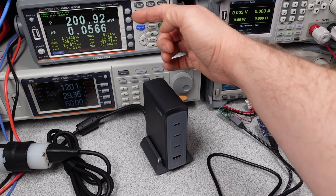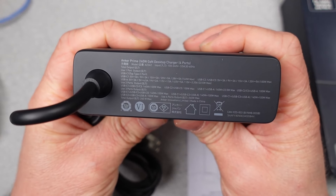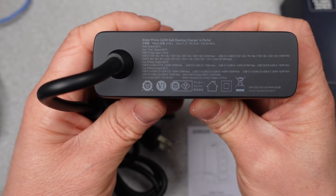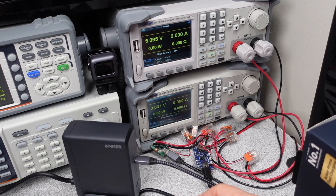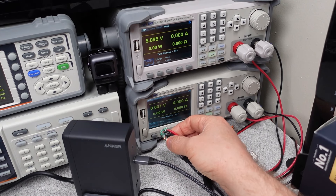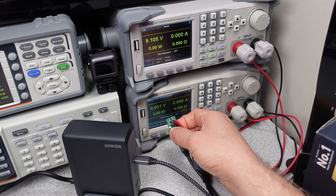This product has a few safety listings on the back as well. It is listed under TÜV SÜD with three countries: Japan, the United States, and Canada. With the fixed power cable, this makes sense. This basically means the power adapter passes some testing criteria related to isolation, safety, and dangerous conditions. It doesn't mean it will last longer or is better at being a power supply though, as I've seen some non-listed power supplies that have performed very well. The power cord is two-pronged and non-removable. This thing is heavy — it comes with a little base stand, and with the heat it needs to dissipate, I recommend using this to keep the adapter away from other surfaces by at least six inches.